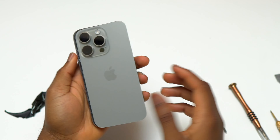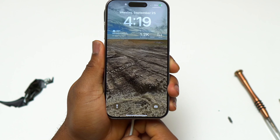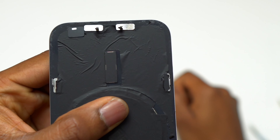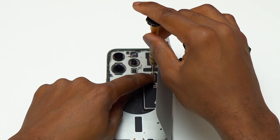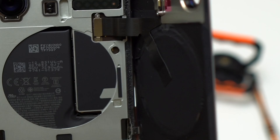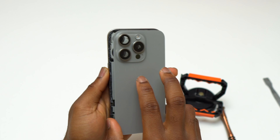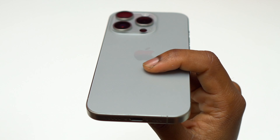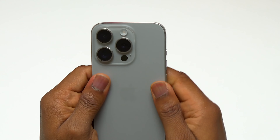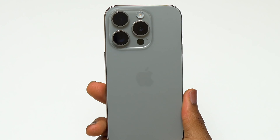The wireless charging coil, flashlight, and external microphone are now all out of the back glass. Reinstallation of the components on the back cover is done and the wireless charging is working fine with no issues. I realigned the pin that was removed and reinstalled it, reusing the double-sided tape to seal the back — though I'll consider this device no longer water resistant. To reinstall the back cover, align it with the frame and apply a little pressure. I heard a lot of clicking sounds while pressing and thought the cover cracked, but it is fine.